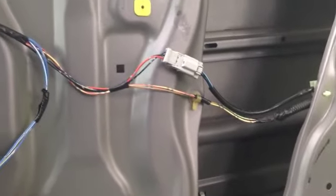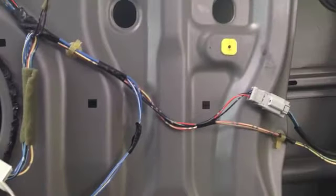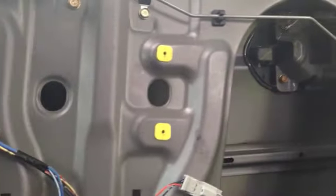I ended up undoing all three of these bolts — there's an access for one of them. You may not have to. What you need to do is see that green piece — it's a little clip over the hinge piece. You need to flip it up and pull that piece out. I had to remove this piece and unscrew that, and take the lock part off to get to it. That's the whole lock system you need to get out. Unscrew the three screws — they're very tight — pull it out, unscrew the lock actuator, pull it out, and unplug it. Plug the new one back in and reassemble. It's not that replacing the actuator itself is hard — it's getting to it that makes this difficult. It's going to take you a while.